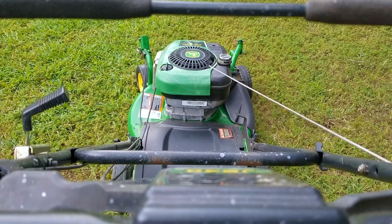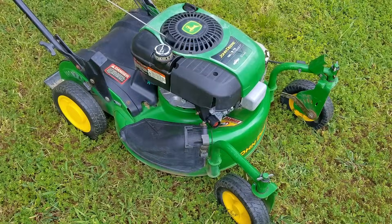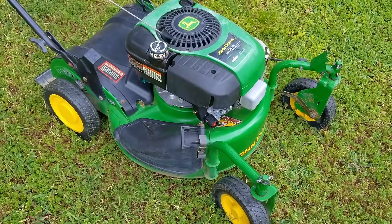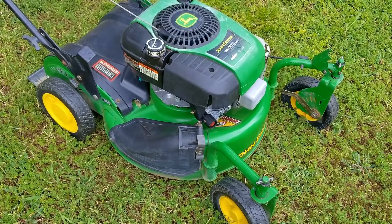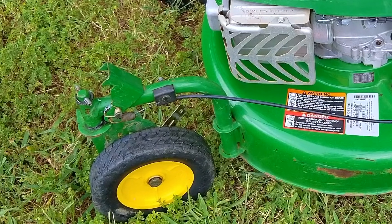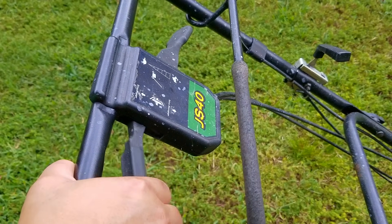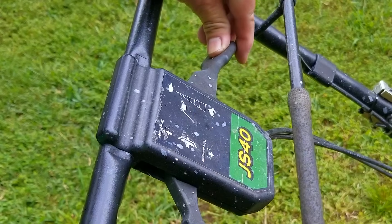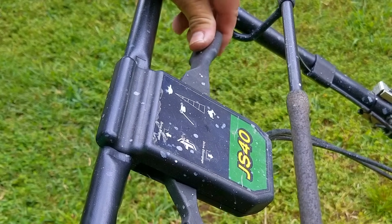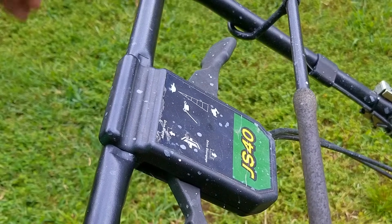As you just saw, it started rather easily this time. That means the water in the carb, along with the debris that was in it, definitely played a part in keeping this engine from starting. I will say that this has to be one of the most maneuverable lawnmowers I've ever used, but there is a major drawback. Even with the left front caster locked in position, there's a fair amount of play, which means keeping a straight line is really tough to do. Also, the hand controls are a bit difficult to get used to because it's not very intuitive — but over time you should get used to it, though in the meantime you're going to struggle with it.